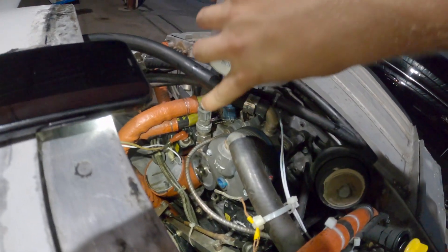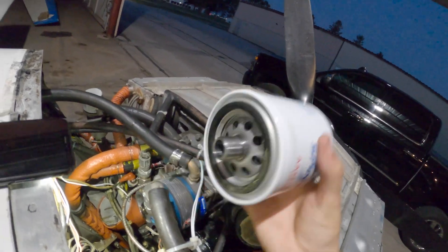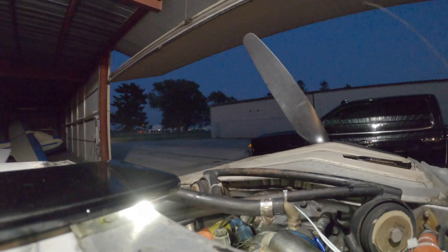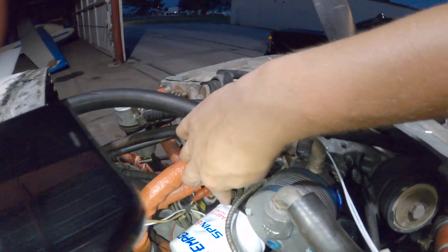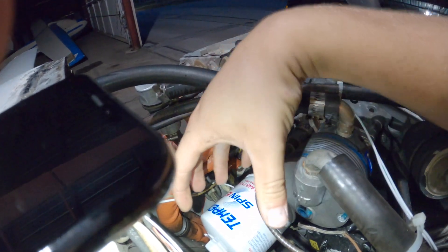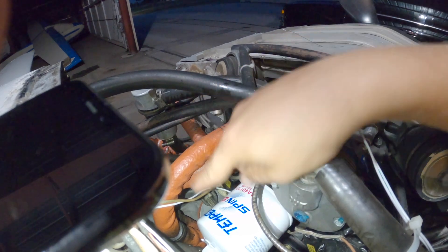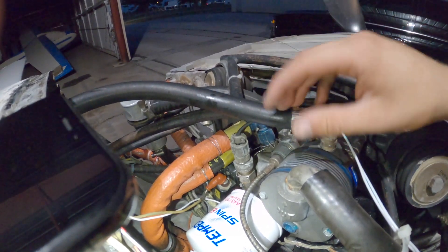So I just want to double check again — make sure there's no lock wire in that hole, nothing too crazy. The filter itself looks clean. I wiped off the white part on the outside and we'll go ahead and feed this guy in and start spinning it on. Then I just tighten it until it's hand tight and then lock wire it. Basically, I'm going to pick a direction so that you're pulling it tight. If our ring is right here where we're tying into, we're going to want to angle it on the left side of the plane so that twisting it tight stops it from being able to loosen. If we went the opposite way, the lock wire would just kind of wrap around until it got tight and it'd be able to get like a quarter turn out of it. So you always want to tighten it so that you're securing it in place.